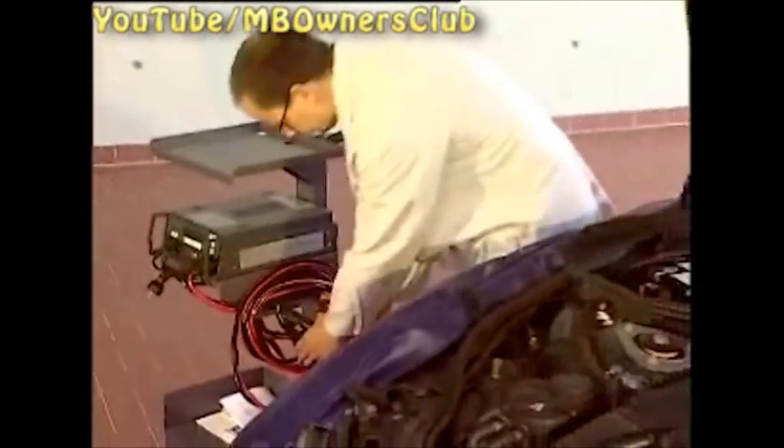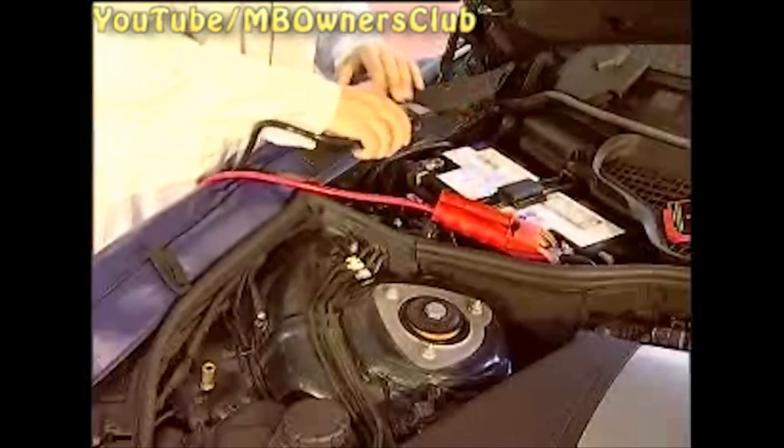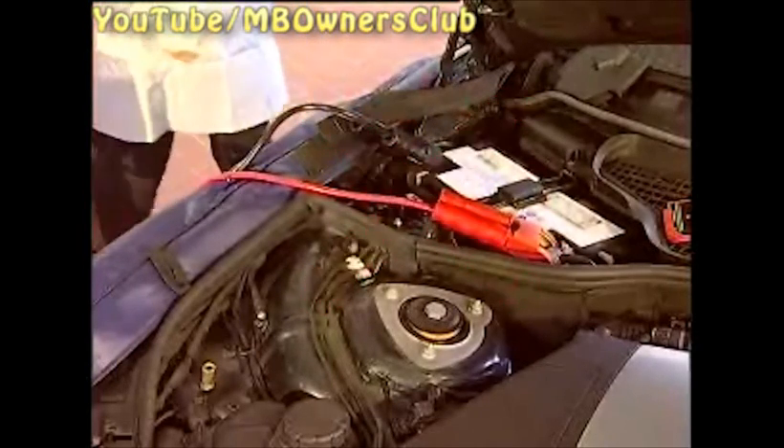Now, back to the battery. For the charging of the new single onboard battery, pay attention to the following. On account of the high power requirements of the model 221, only battery chargers with at least 30 ampere charging current may be used. The battery may not be charged by connecting directly to the negative terminal, because otherwise the charging current will not flow through the intelligent battery sensor, and the battery level will therefore be taken as the old level.